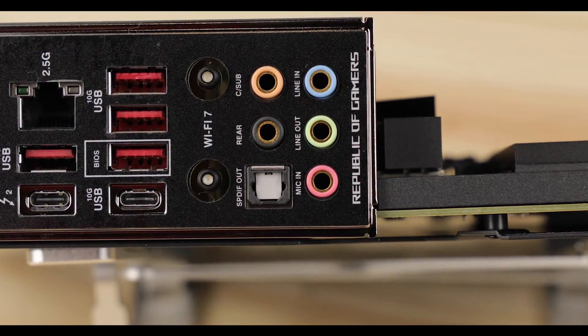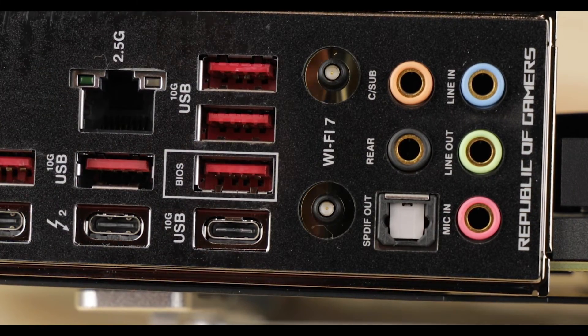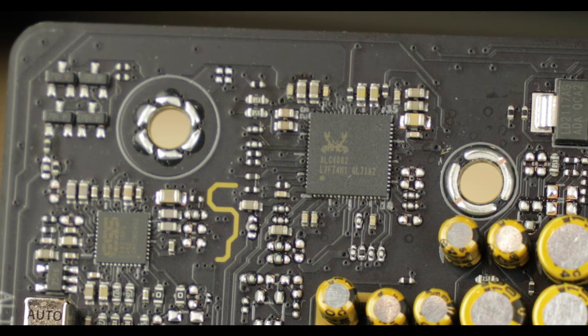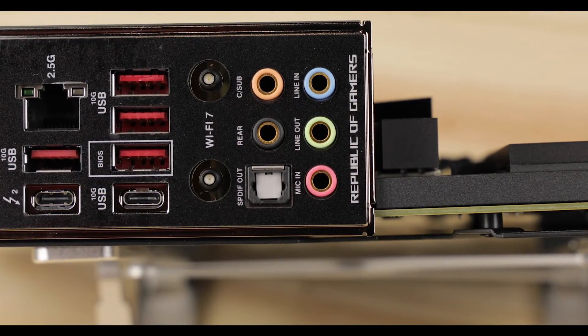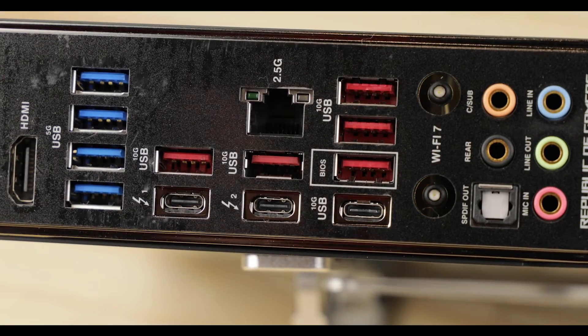Luckily we do have an upgraded Wi-Fi 7, which is a first on Asus motherboards and will bring you even closer to fiber-optic quality internet over the air — that's great. Asus also tried a slight innovation with their push-fit Wi-Fi plugs, so you no longer need to screw in the antennas, and they are genuinely easy to connect. Finally, we have the premium all-digital ALC 4082 audio codec from Realtek, serviced by healthy 500 microfarad signal-cleaning capacitors, coupled with a very good ESS ES9218 quad-DAC — notoriously good for studio-grade recording — especially interesting for streamers.